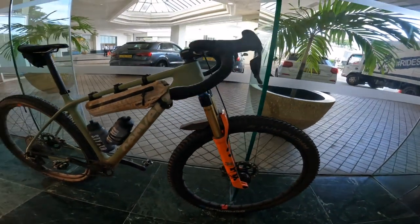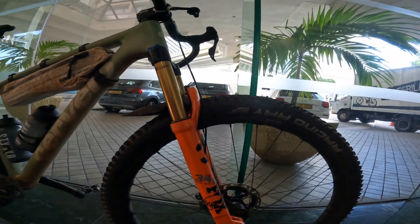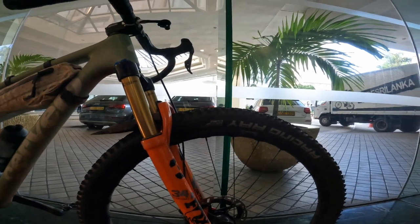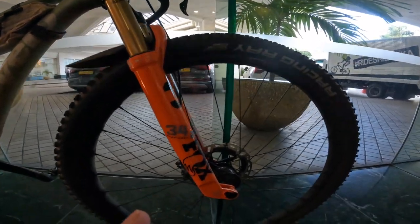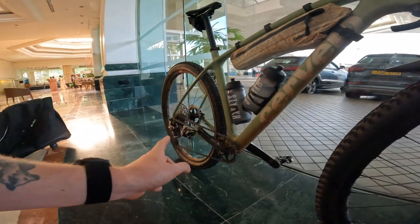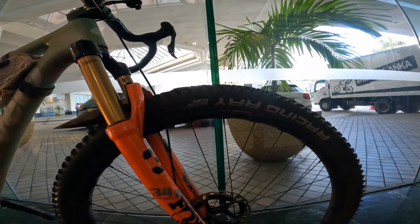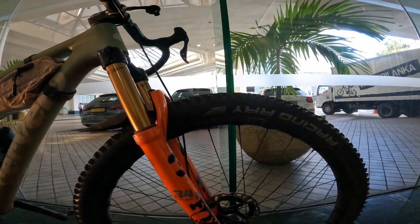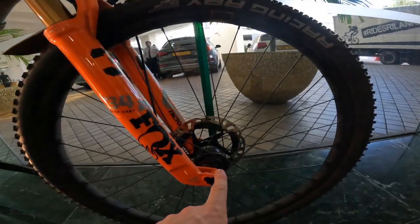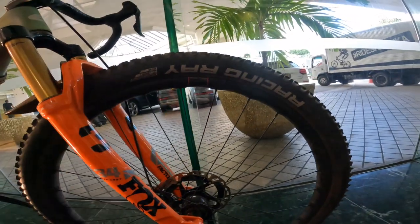The wheels are interesting because they're not the same wheel although they look like it. The front wheel is a Reserve Mountain Bike 30. The reason I'm using a Reserve 30 on the front is they've got a slightly higher spoke count, which allowed us to build it up with a dynamo hub. The rear is a Reserve 28, which has a lower spoke count — the rim is pretty similar, it just has fewer spokes. The 30 is specifically needed for the boost mountain bike dynamo hub, as you can only use it with 30 spokes.